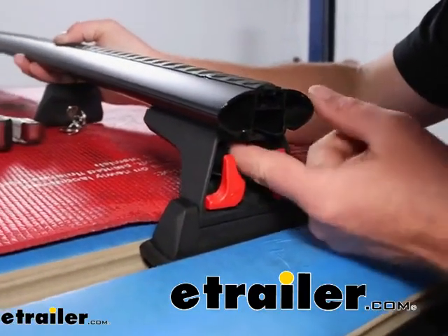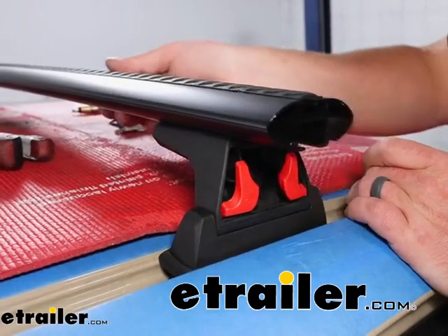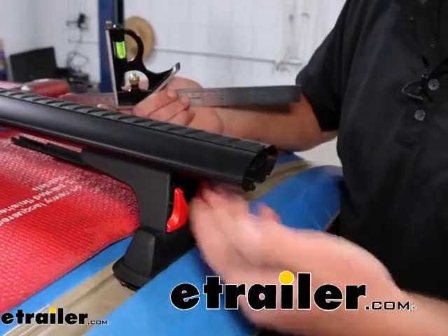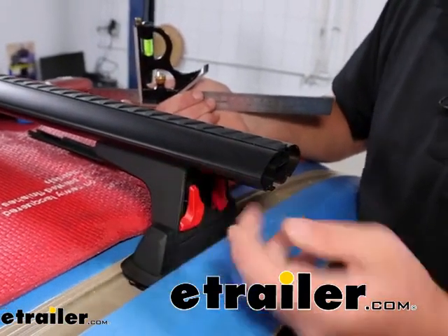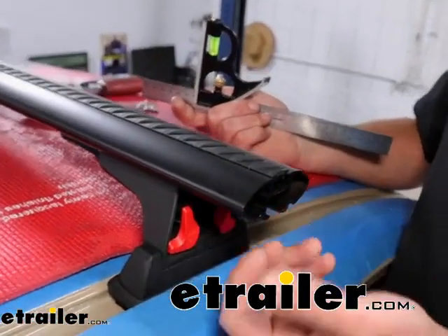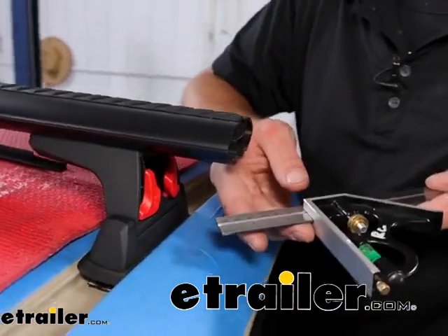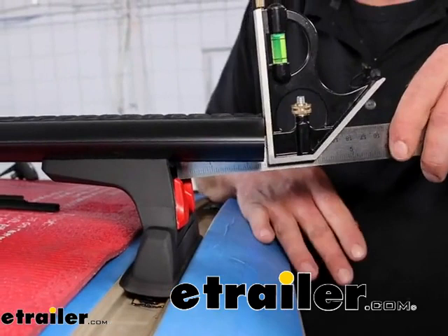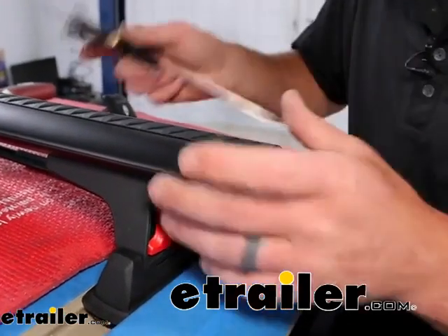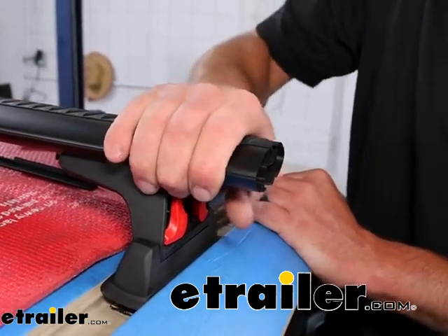With the rubber strips in, we're ready to get the crossbar in place. On the mount pieces, there's a square nut with a bolt coming through and a track guide. The divots in the crossbar ride in that groove, and the square piece sits inside so when you tighten it, it draws the crossbar down. Loosen the bolt enough so the crossbar can slide in. Once you have both sides started, find the proper amount of overhang — split the difference so it's the same on each side. A square tool is really useful here to quickly check alignment and lock it down. Tighten that Allen key to lock the crossbar in place and prevent it from moving.